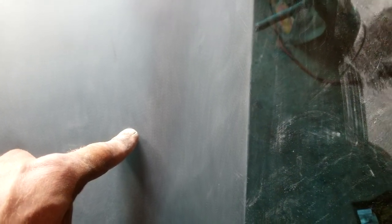What I'm gonna try right now is wet sanding with 400 and see if I can get any clarity out of it. I could see a light going through it. This, you see, this is good. This is non-sanded versus this sanded. I'm gonna try wet 400 and see if I can get any clarity out of it, and then maybe 800 and so on and so forth.